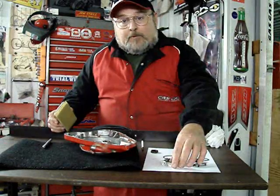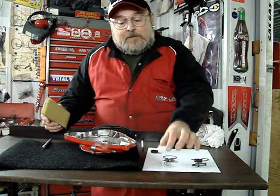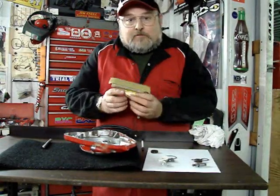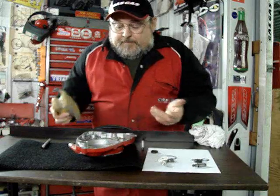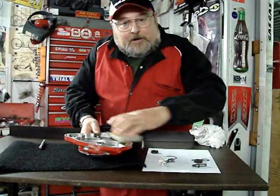What I do after I have my water pump apart — because there's a gear that sits here that's above the surface — is I have a sanding block with 220 grit sandpaper and I run it around the cover. This gets rid of the final remaining gasket material and makes for a very good seal.